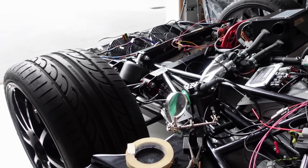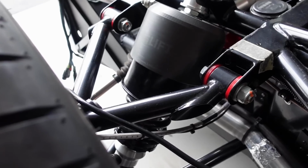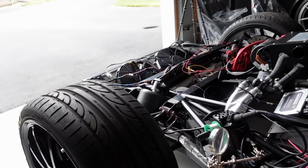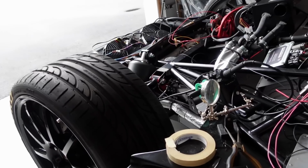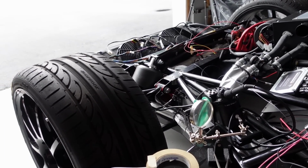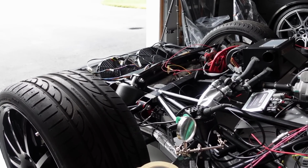We're gonna go up first, and there you go, you can see the piston comes out there. It's about 1 7/8 of lift, I noticed, I measured it, and the front is a little bit aggressive. I'm a little surprised. I mean, there's not a lot of weight up there, and it does raise a little bit aggressive.